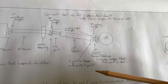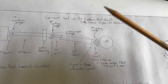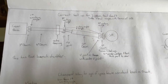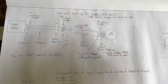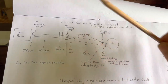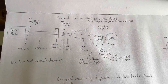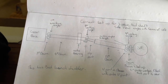Work out a halfway figure between drive and coast for your pinion climb. Under load the pinion tilts up, and under coast it will climb down. They always say you should tilt it about 1 degree down, so the 9 degree static working angle was set so it would tilt up to around 8 degrees operating angle under drive. I tried raising the centre bearing mount so the first tail shaft was at 4 degrees — it ran smooth, but had the world's worst launch shudder, like hopping tyres at the lights even at gentle acceleration. It was rubbish.